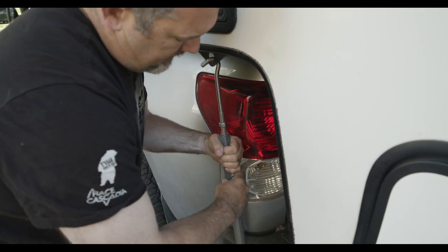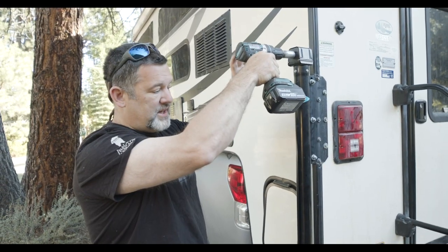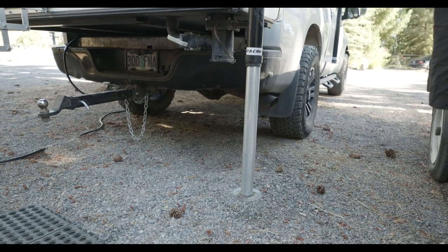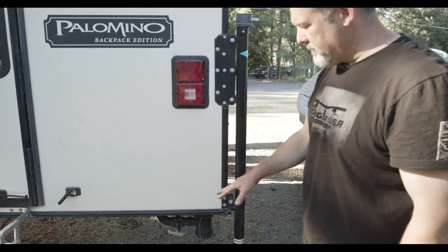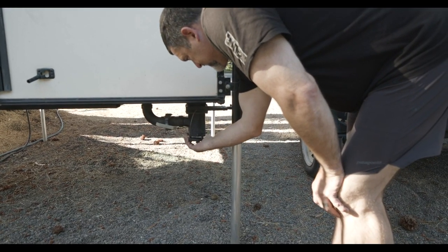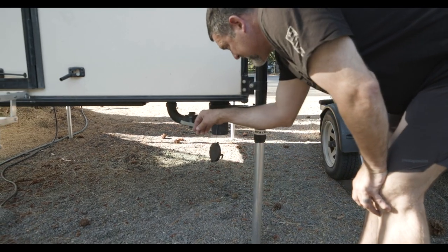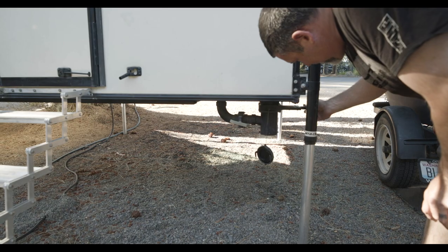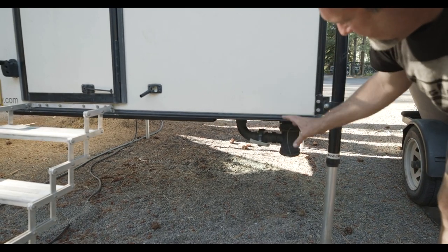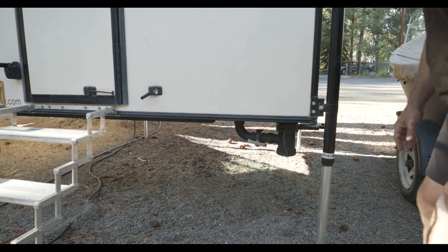To take off this camp trailer, it's tied down with four different connecting pieces. This allows you to keep the camper at your site without having to have your vehicle underneath it at all times. This part here is where you dump your gray and black water at a traditional RV site — you twist this and put on your pipes to extend it into an RV dump site. Pulling this lever releases the gray water; pulling the one on this side releases the brown water. What I love is that it's pretty straight — no big S-traps to get things stuck in. Everything comes out fast and efficient.